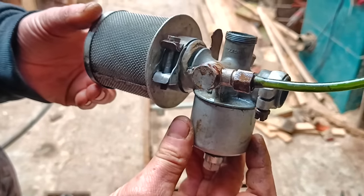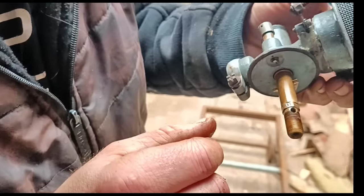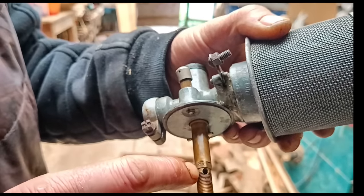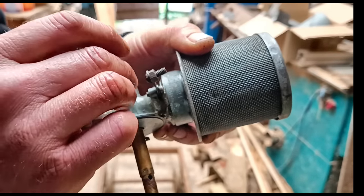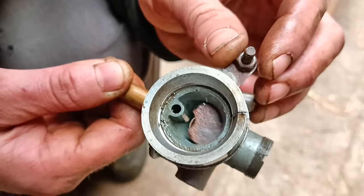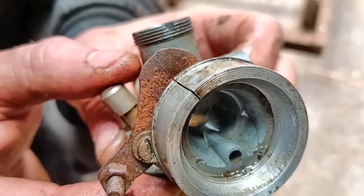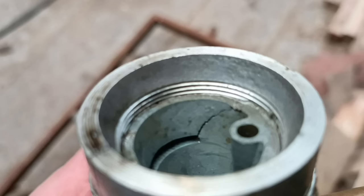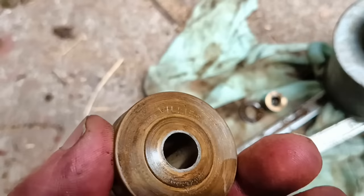We can look at the float now. The next day, Ashley came around and we delved a little deeper into why it wasn't running smoothly. There's gelled fuel in the needle hole, though the fuel line was clean. So that's the strangler. We quickly discovered a crack in the carburettor — it has been mended, but not very expertly. Just giving it a good clean and blowing out the jet seemed to help.